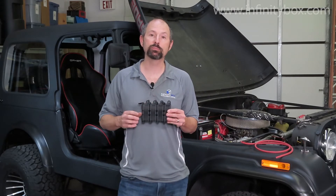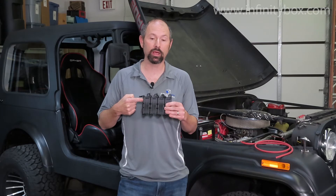Also included in your kit is this block of four mega fuses with a common bus bar at the top. You're going to bring primary battery power into the bus bar, off the positive terminal of your battery, and then each of these four fuses protects one of the 8 gauge cables — two for the front power cell, two for the rear.